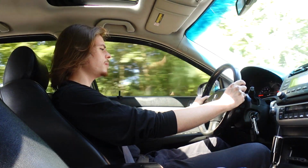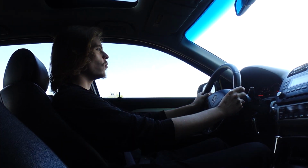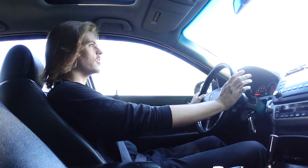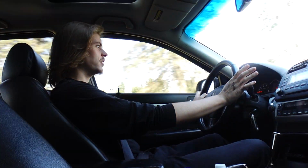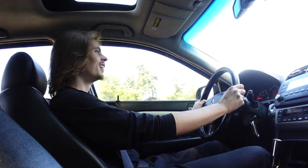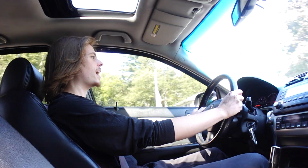But I still have a little bit of shake in the wheel, and I have to assume that that's just alignment. I'm definitely feeling some wobbling and bobbling a little bit still. And honestly, you guys saw in the last vlog that the tire was really worn down on the front right too. And so having drastically different tires, like one worn down really bad and one that's kind of fine, is going to create a little bit of that unsmooth feeling, I guess you could call it. So I'm trying not to be too worried about that.